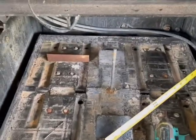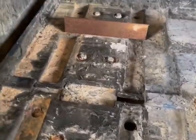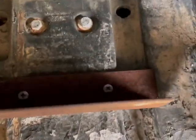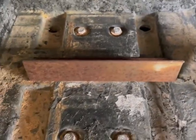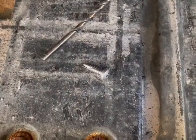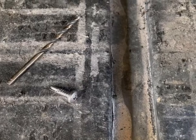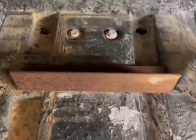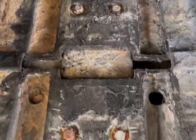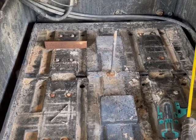To give you an idea of what I'm doing: I like to have my batteries centered, and that's exactly what I did with this one. I take that stop, center it approximately five and a quarter inches from the inside back, and fasten that piece in there — it's as wide as the battery. Drill some tapping holes. I do not use self-tapping screws — I found that if I try to run that in, the plastic balls up around it and it doesn't make a good connection. So I drill it out ahead of time and then run a wood screw or any coarse-threaded piece you want.